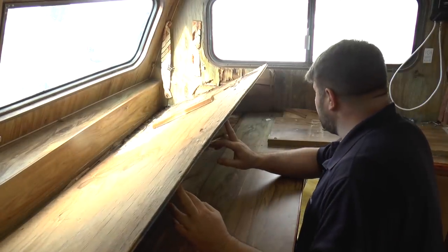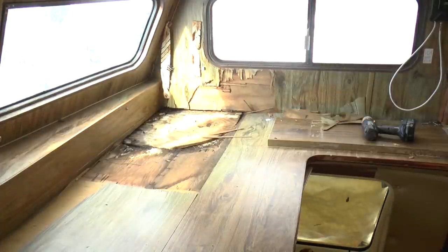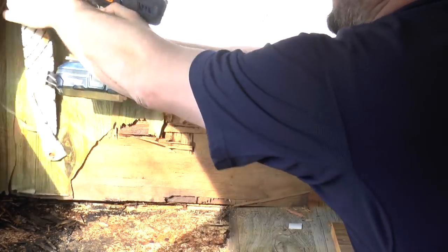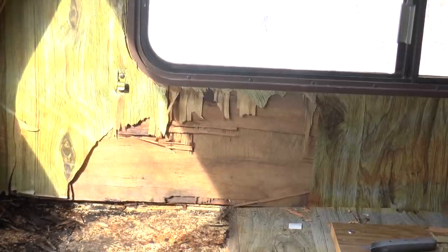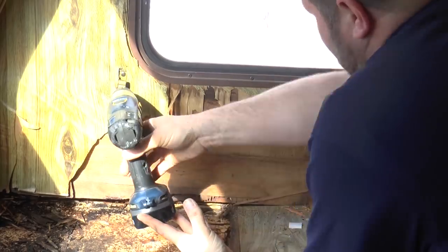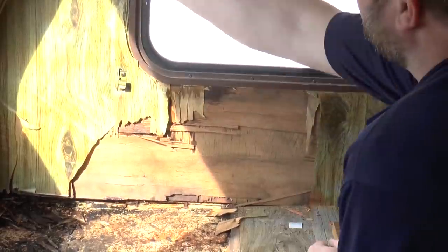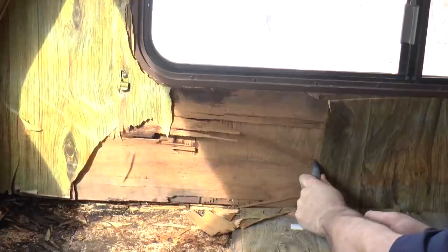Starting off, we're going to go ahead and remove this piece of half-inch plywood — carefully getting it out of the RV without scraping up the walls. This is an old repair that somebody had done; you can see all the mold on there, so we're definitely going to remove that. That was three-quarter inch plywood with a little section cut out. Now we're going to remove things that are screwed in — the curtain rod holders. If they're too rusted you're probably just going to have to pry them off, which is what I had to do. You can use a Dremel tool to grind them off or just use a hammer. Then we'll take a razor knife and cut around the window — this material is water damaged so it cuts fairly easy.